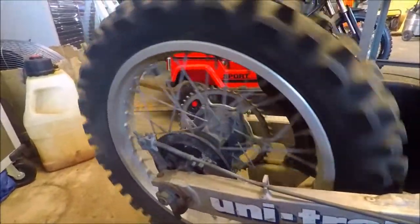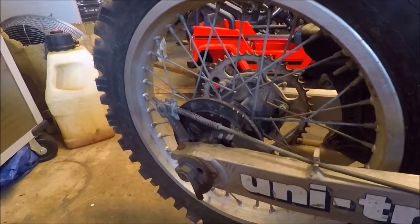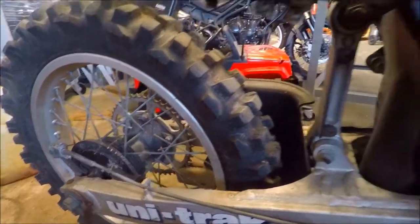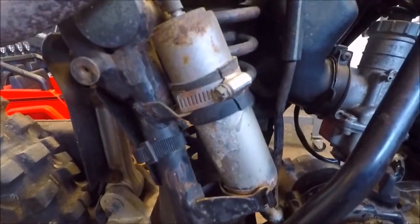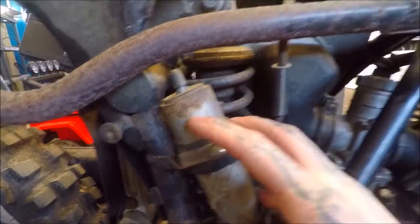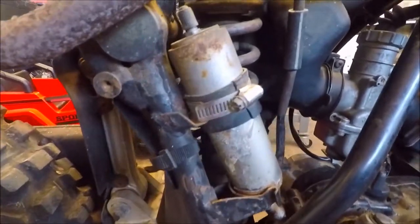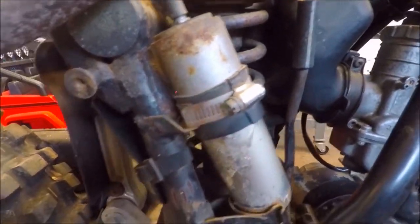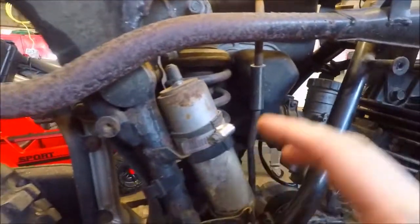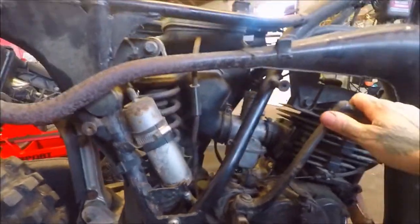The rear brake does grab a little bit, so we will be replacing the rear brake drum assembly and the brakes inside. We have chain and sprockets — obviously that's something we're gonna do. The rear shock — I'm not sure if we're gonna rebuild this or not. These are really cool because that's an air nozzle so you can pump air into it just like the front forks and adjust the compression. I'll need to look a bit more into these Uni-track shocks — this was top-of-the-line when Kawasaki came out with this on their KDX line.